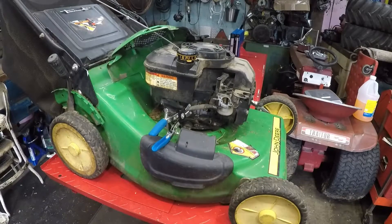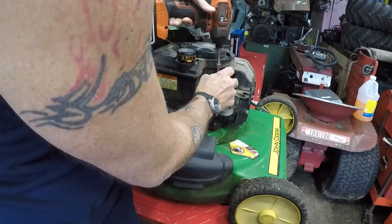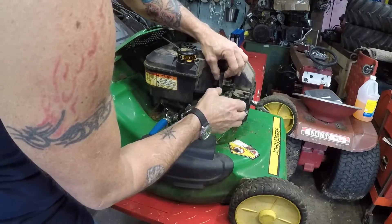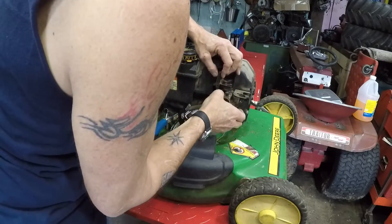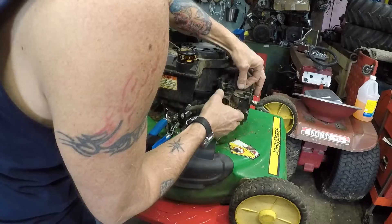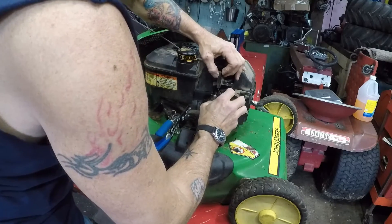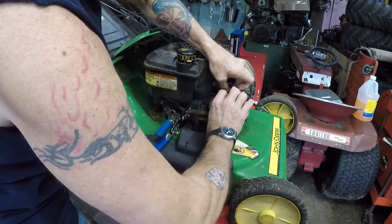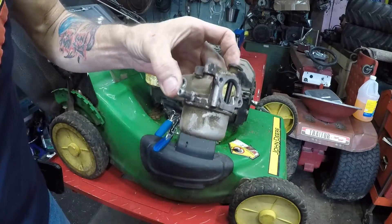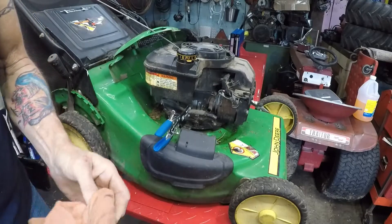That one is smaller - it's quarter inch. I will not be putting things back together with the impact. That gets that off. Now we need to get the carburetor out far enough. Let me go ahead and pop that throttle spring off too. Loosen that up, now we'll back it off, and we'll tilt the carburetor down and just pop the linkage - just like that. There we go, we've got the carburetor up. Pop this part, take a look inside, see what's going on. Should be able to clean it up without any problem.